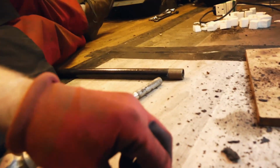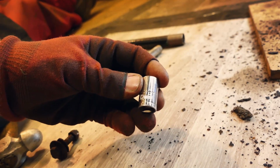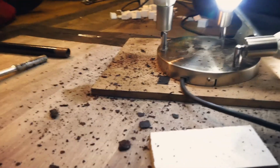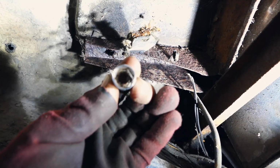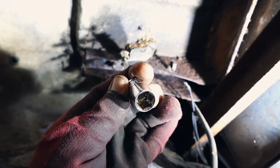and I have another 12-inch, not 12-inch, 12mm. Have I been saying 12-inch the whole time? Whatever, 12mm socket. And this is the part where I should have had a tripod. Never mind. Yeah, as you can see, we've got some rust. As I've been hammering on it, it's all sort of fallen off. But it would do. Before I actually put this socket on, one thing to note. 6-sided socket. Try not to get 12-sided ones, because they're rubbish. Mind you, no, they're good for some jobs.